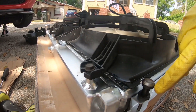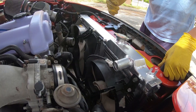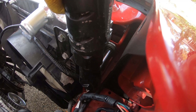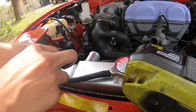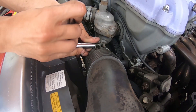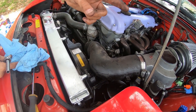After you get all the fans transferred, reuse your old mounting brackets — the pins come out and there's just a little C-clip on the bottom that you pop out on the old ones, then press them back in. Also reuse the rubber grommets because you don't want anything vibrating metal on metal. After you get it in, start running your clips back for your fans. It's a nice snug fit and all tightened down. Plug in your overflow hose, connect the upper radiator hose, and everything on the top portion is set. Then plug the bottom of the radiator and reconnect the lower radiator hose.